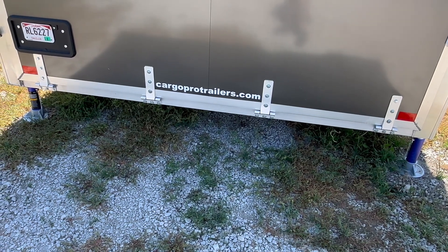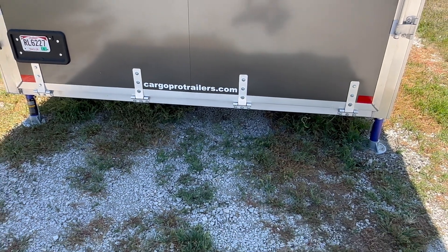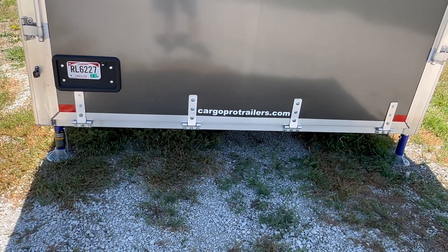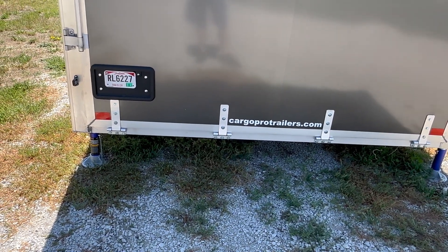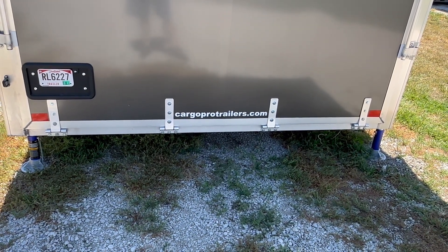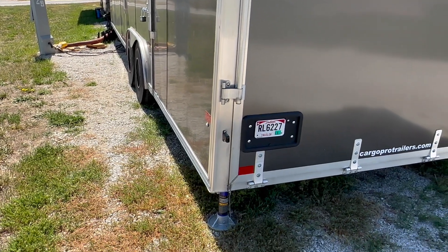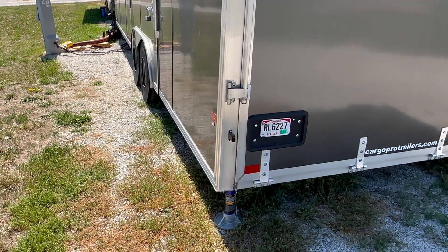It didn't feel dangerous, just made some creaking noises, which is probably normal. We have these jacks that we use for getting the car in and out when the trailer's not attached to the motorhome. What I discovered a few minutes ago was that with the car in there they've settled down firmly — the trailer is firmly on the tops of the jacks to where I can't pull them out. I have to get the car out to relieve a little bit of that pressure, otherwise raising and lowering the house could put strain on these jacks, the trailer, or the hitch.